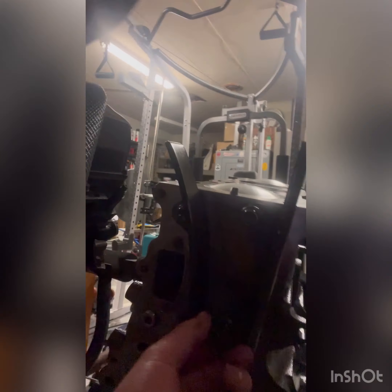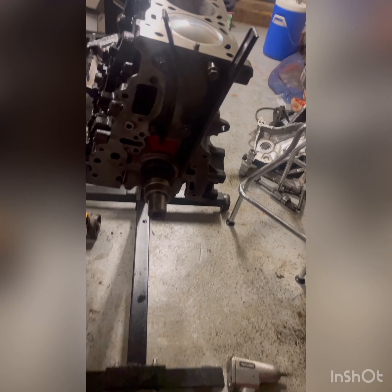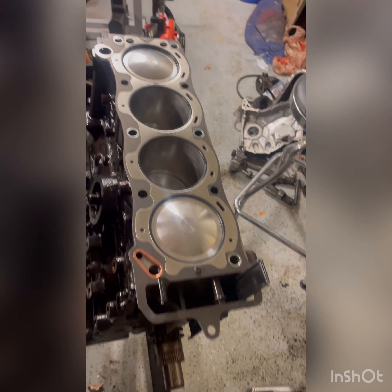It's been a long time since I took this apart, but luckily I took a lot of pictures and labeled bags. You have to label your bags when you're taking stuff like this apart and take a lot of pictures, otherwise it will never go back together. I'm starting with these guides - I have them just finger-threaded in, I have to tighten them down, and then I'm going to wait to put the tensioner on until I have the chain on. So I'm going to put the head on now. Here are all my gaskets for the whole engine and the head gasket is on.